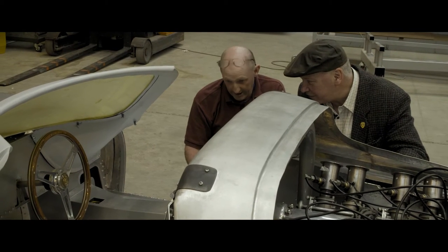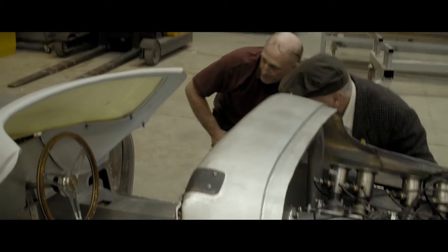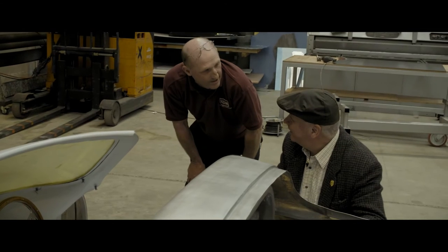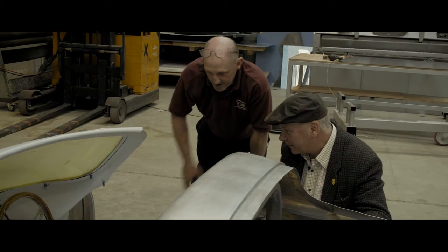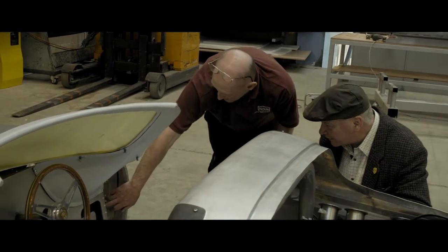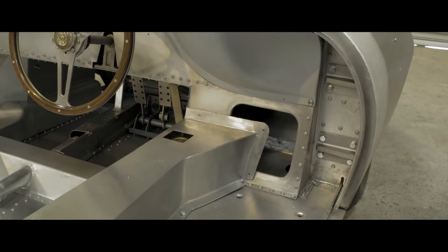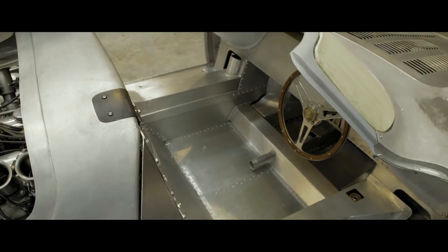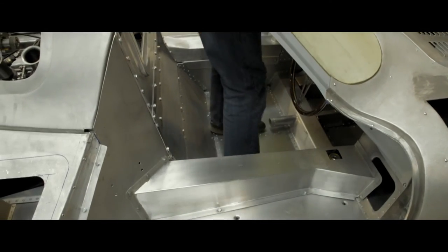Fuel tanks will be fitted in the sills. The original had bagged tanks, but we're going to put in proper aluminium tanks that can be taken in and out in case of leaks - I think it's a lot safer. You've replicated all the hinged detail - Paul drew all that up on CAD and they fitted quite nicely. I see you've done the floor as well - it's ever so strong if you stand on it. Eventually you just stand on your seat and slide in.